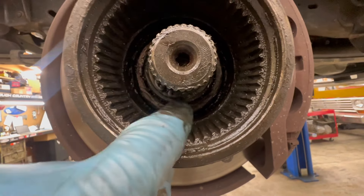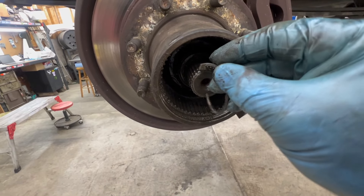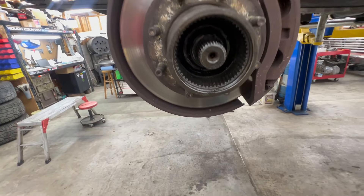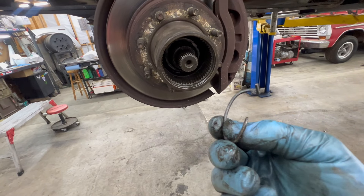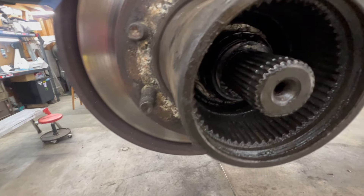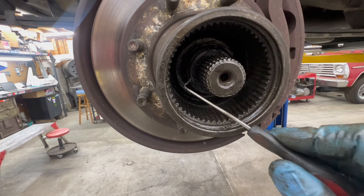We need some snap ring pliers for that next locking ring — we're going to pop that one off. I found this piece laying in the back here, and what this is supposed to be is round, not bent. It fits right around the axle and goes in this notch up at the top. That's another locking mechanism to keep the nut from backing loose. With the Super Winch setup this is a little bit different than the factory setup, so we're going to have to see if we can get a new one. Now we got our other snap ring removed, and there is a very thin washer that is keyed and splined with the axle — you can work that off.